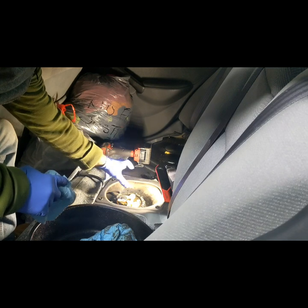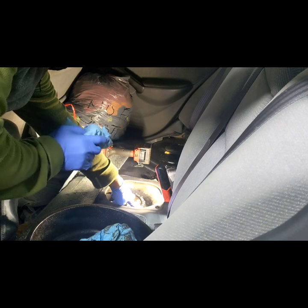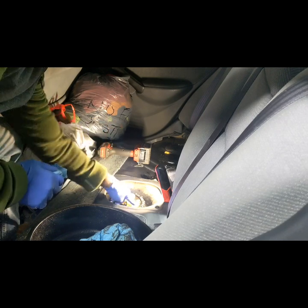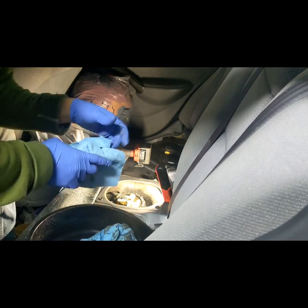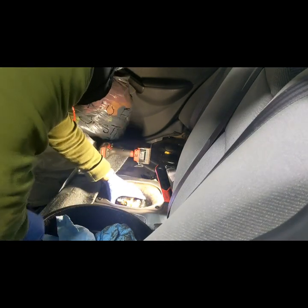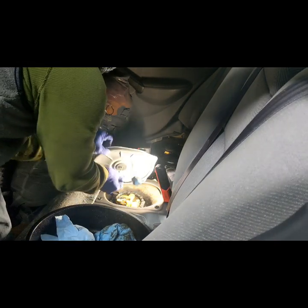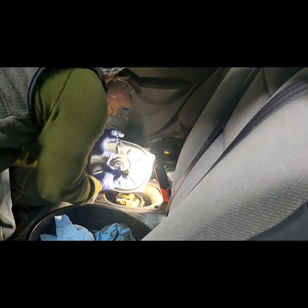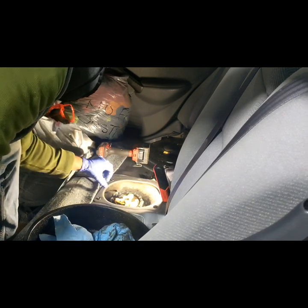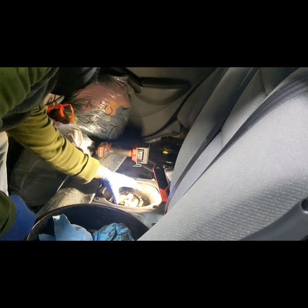This should come off by hand. If it's too hard, get a piece of plastic or wood and try to tap it here. If you use a screwdriver, make sure you wrap the end in a rag — you don't want to make any spark. There's going to be electrical under this cover, so press on the tab and unplug it, then press the two little tabs and unplug the line.